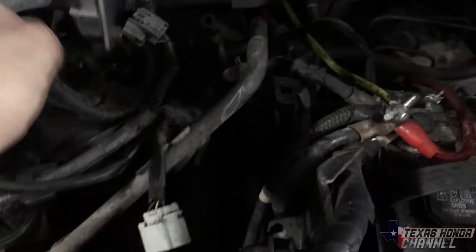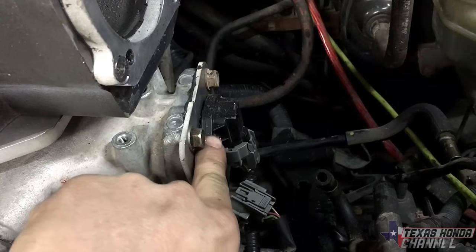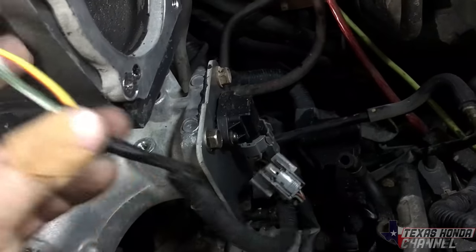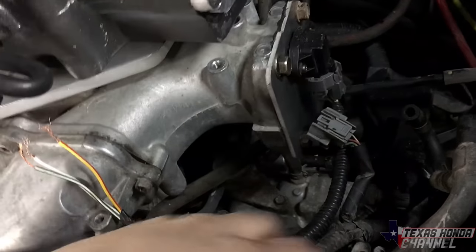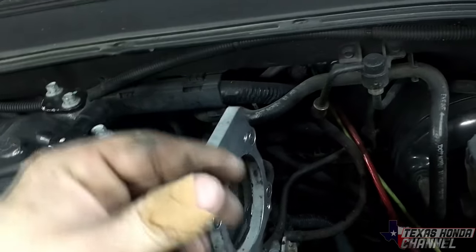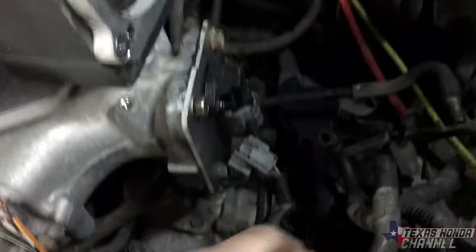Now what we will have to do, here's the map sensor I showed you earlier, the wiring for the 1988 to 2000 Honda Civic D series, B series, H series, F series, I believe. These are all the same map sensor style. This will all be wired, which I will have a diagram of once we actually do that wiring, which is coming up real soon. It'll be next on the list. This here will go to the very top of the throttle when it's up here. This is for the air idle control valve. So we're gonna actually not necessarily cut the harness open, but pull the harness open and extend the wire so we don't have to actually cut and extend.